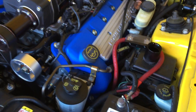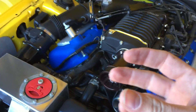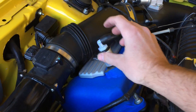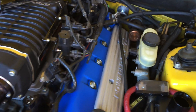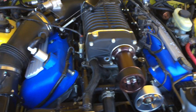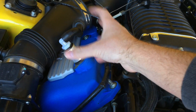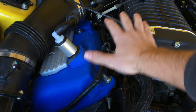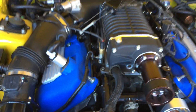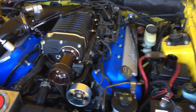You do want to make sure that you dump the oil out so it doesn't overflow and get sucked into your engine. As an alternative, there are several kits on the market — some are just a little filter that looks like a car's air filter called breathers. They just stick on each of those open ports on the cam covers and they work, however under wide open throttle pulls you'll see the filter mist as the pressure gets pretty high, putting oil all over the engine.